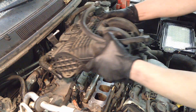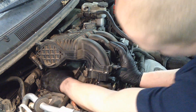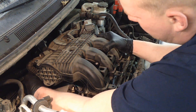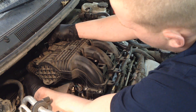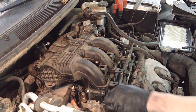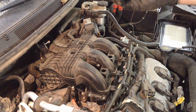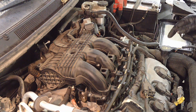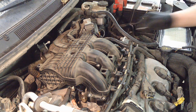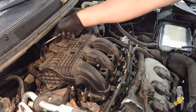After that we can start lowering it down. First thing to deal with is this connector we took off earlier — that's for the heated PCV — make sure that's connected up. Then push the PCV line all the way on and we can start lining up these ports. Put the little 8mm bolt that supports the intake underneath the throttle body in by hand right now. Get the upper intake bracket aligned by hand as well.